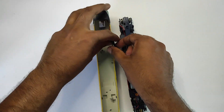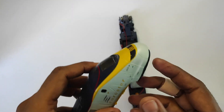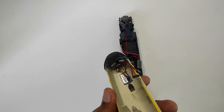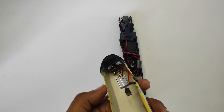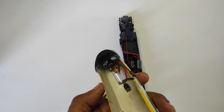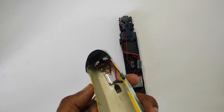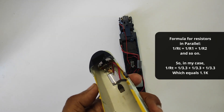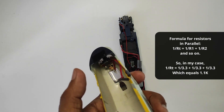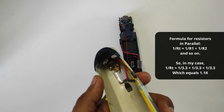A little aftermarket modification I did to this was installing some lights. You can just about see the LEDs and the resistors there. This was made really easy because inside the plastic lighting binnacle there are four perfectly formed two-millimetre sockets where the LEDs can just easily slot in — no gluing or cutting required. Where resistors are concerned, you typically put a one kilohm resistor in series with your LEDs. I didn't have one kilohm resistors in stock, so I took three 3.3 kilohm resistors and wired them in parallel. One over total resistance equals one over R1 plus one over R2 and so on, so one over R here is 1/3.3 + 1/3.3 + 1/3.3, which equals 3/3.3, giving a total of 1.1 kilohms — pretty close.